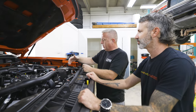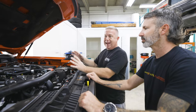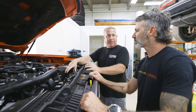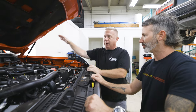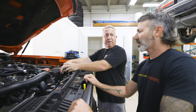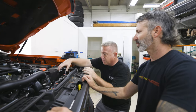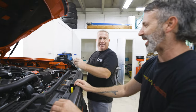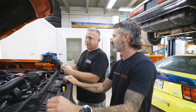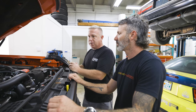It looks like the mounting location is still going to be the same. Some people ask why we have such long hoses. This is going to be the most up-fitted product since the Jeep. There are air compressors and air lockers going here, so we're not trying to take up space from other products. We want to make sure it's easy to reach and everyone else's products will work around it. We can't have someone five-foot trying to reach over there for a catch can. The hose length really doesn't make a difference — in fact, it helps to catch more oil sometimes. We'll mount it here properly and get a couple of different options for customers. Having it here makes it really easy to drain.